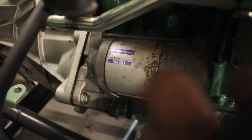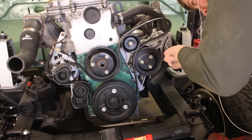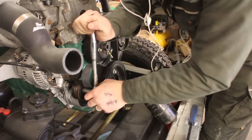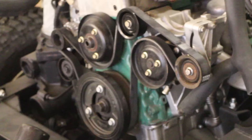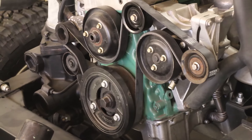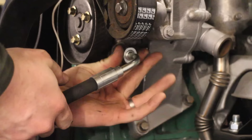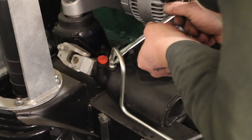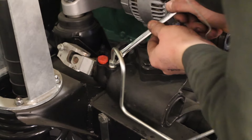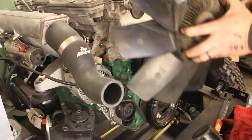We've put the starter motor back in, and I'm also fitting the drive belt with new pulleys all around — quite a simple job: just release the tensioner, get your belt on, then let go. After that I'm putting in the pipe that connects from the power steering pump to the steering box — again a replacement pipe. If you can do it and afford to do it, just do it right and do it once.